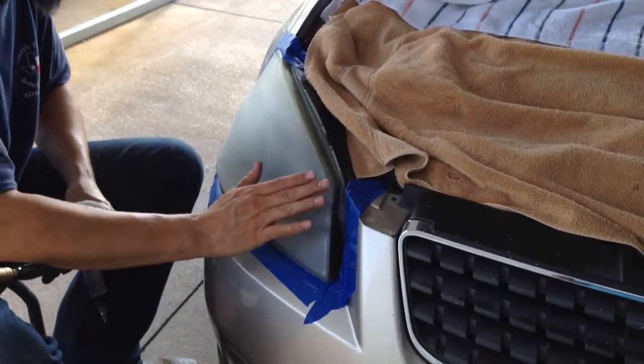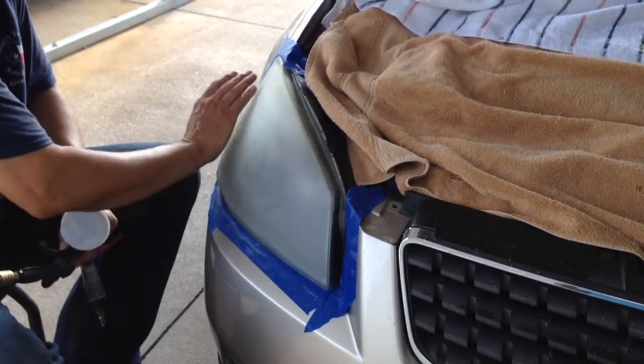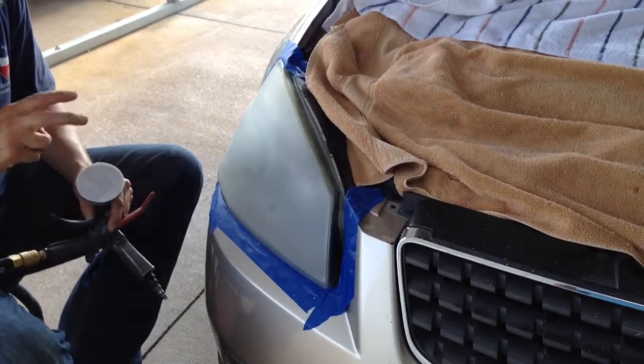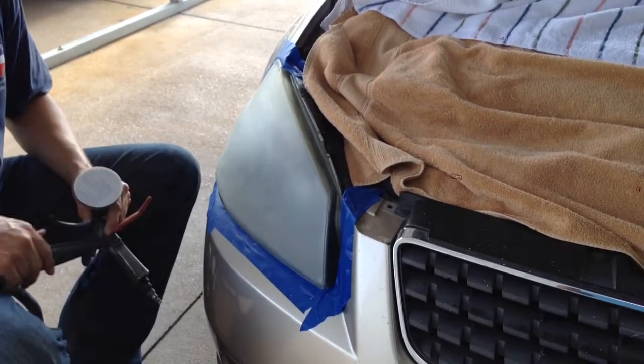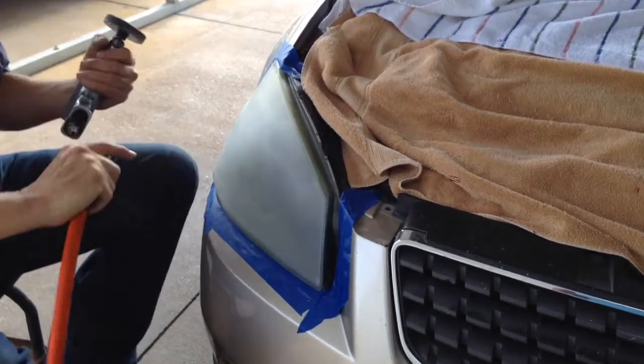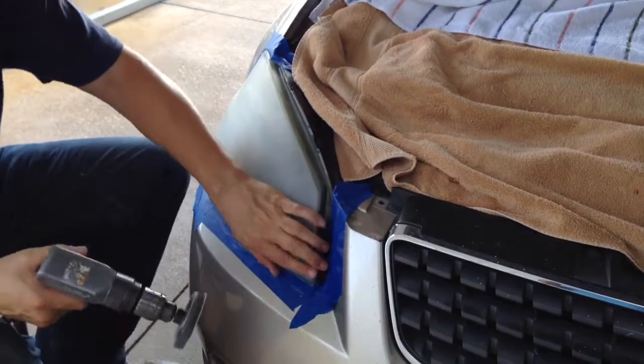You just have to pick a section of the headlight and sand it real good, and work your way across. Make sure you don't skimp on the 800 grit. You got to be careful. You only get 2 of these pads per headlight. The 500 grits you get 3 or 4, and you don't want to use these up and not have enough to do both headlights.